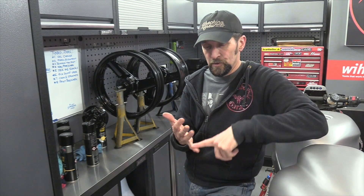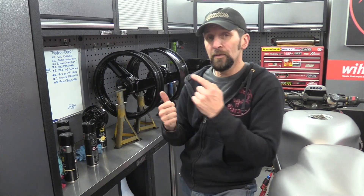Once the back end all goes back in and the wheels go in, I'm ready to call Mackie for the paint. There's a little bit more to do - that swing arm, new shock absorber going in, new swing arm bushes which I think is essential. Replacing the swing arm bushes will be quite a big video. For the wheel bearings, I'm going to pull them out with a proper bearing puller this time rather than hammer and drift, and show you how to use a proper puller. The swing arm bushes cannot be hammered in - they're too fragile and you'll ruin them. They have to be pressed in, and if you don't have a hydraulic press, you can use threaded bar, nuts, and sockets - I'll show you how to do that when the time comes.